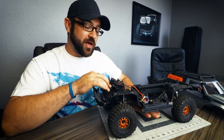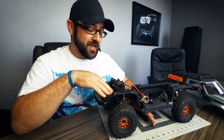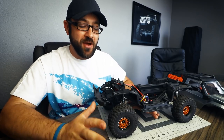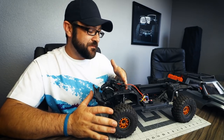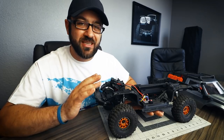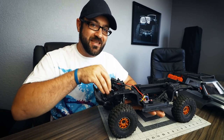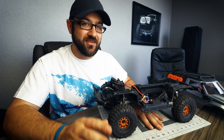I don't love this front battery area. While it does give me a forward weight bias, it's really high up there — that's a high mounted battery. I wish I could find something that fit nice and low on the side, and that might be an option we look at down the road. But for now this is the best situation, although still not ideal.